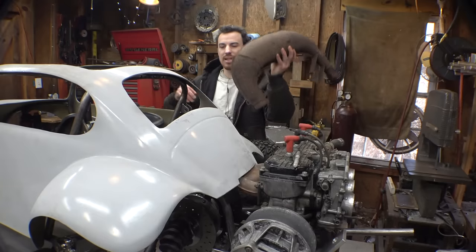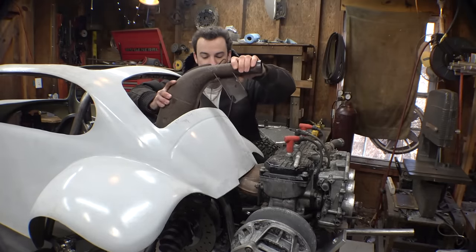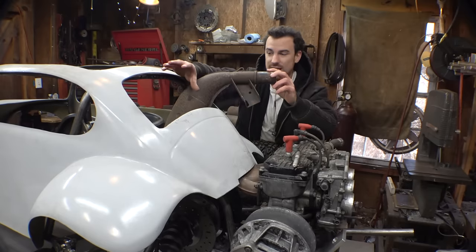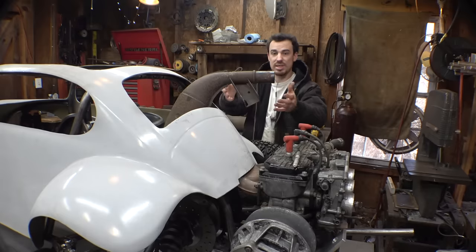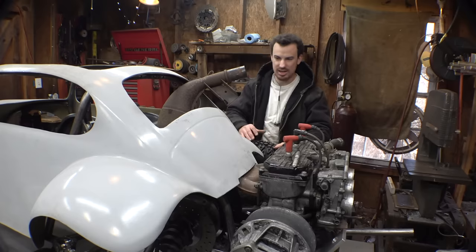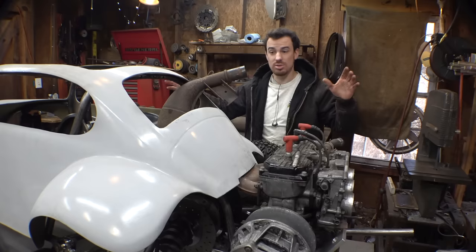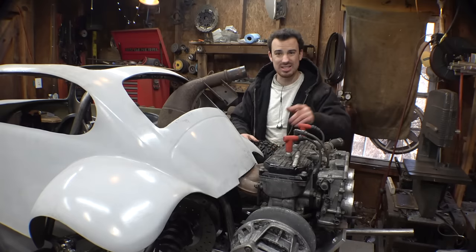Now, actually, I was thinking about this. I will admit, a much better spot for the expansion chamber is just simply putting it right here and having it stick out to the back window, but this is where the radiator is going to have to go, in this back window. If I could figure out a better place for the radiator, I would put the expansion chamber here. It's not in the way of anything, it's not close to the tires, it's not close to where I'm sitting, and it's really just the best spot for it, but I can't figure out anywhere else to put the radiator, and we kind of need a big radiator, because we don't want this thing overheating.